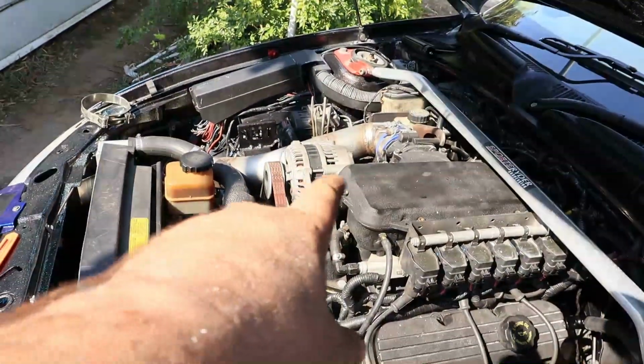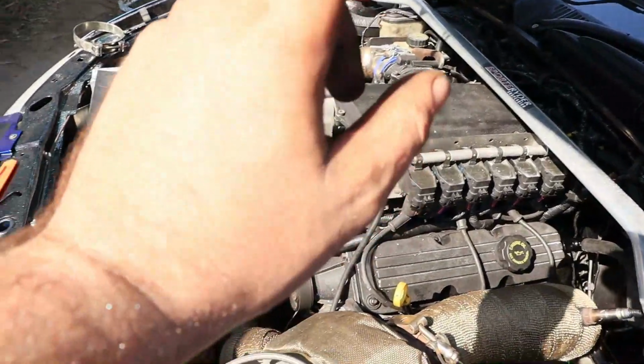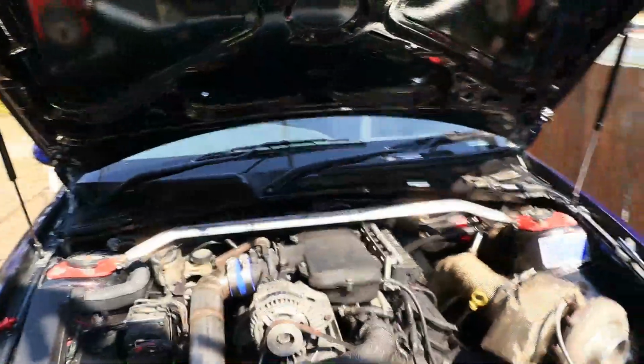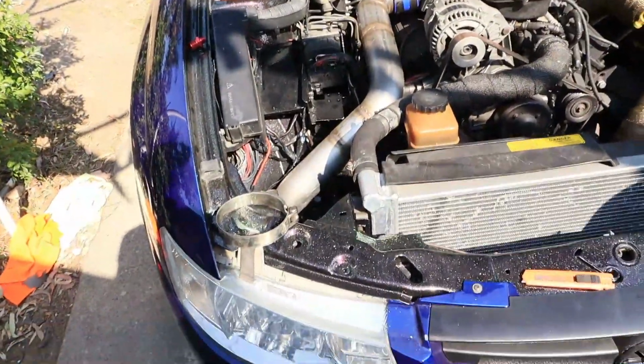So for today, just going to quickly pull that pipe off, pull those 3 plugs out, we'll have a look at them. I'll quickly gap them down and then put the pipe back in, and then I'm going to call it quits for today, just because it's freaking disgustingly hot.